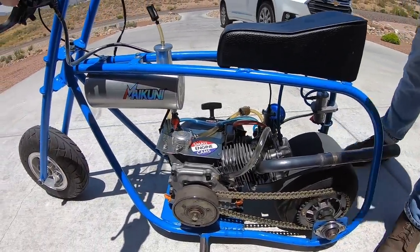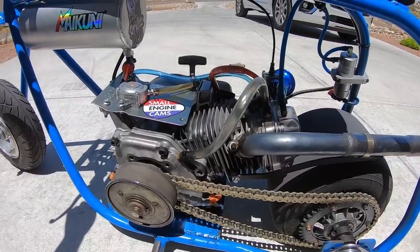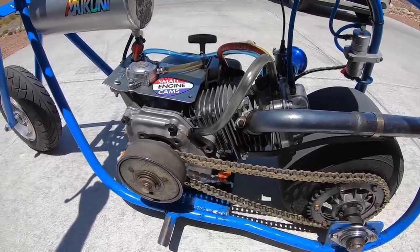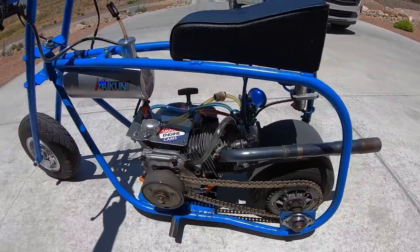Oh, okay. That's the whole point of this venting from top to the bottom, is stabilizing the ring seal at high RPM. And it also does help the engine lubricate the top end, because there's a lot of oil flow that goes in that hose at speed. When you're on the freeway or cruising at 6,000 RPM and above, you look down there, there's so much oil going through that hose, it's crazy.